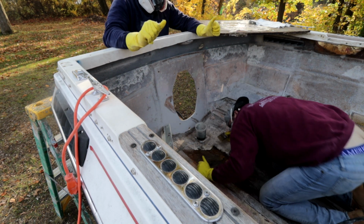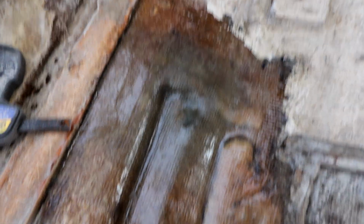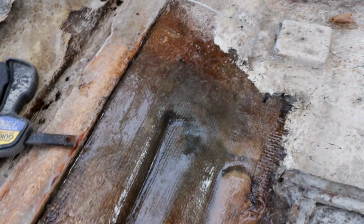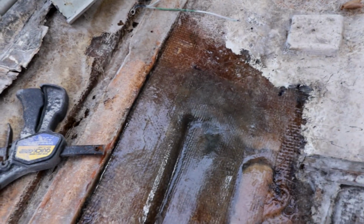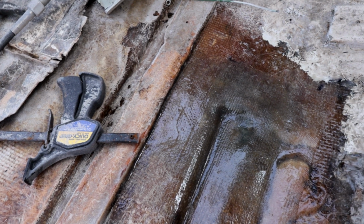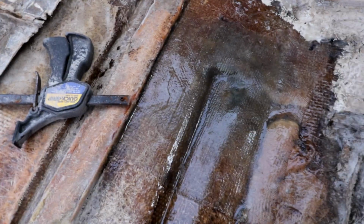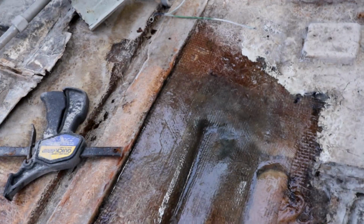Pretty impressed. Alright, guys. So we got our big ol' corner patch in here. Just got as many of the air bubbles out as we can. Took about 350 mils of resin with the 4 sheets that we did. Let her sit up a little bit. We'll probably pick up a little bit, and then in the meantime we'll hit these other ones with the PVA, and see if that gets the tackiness out of them, get that oxygen out. So see how she goes.